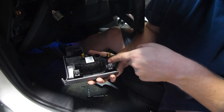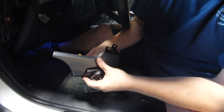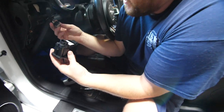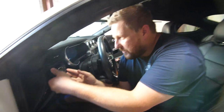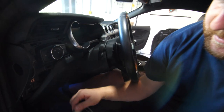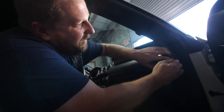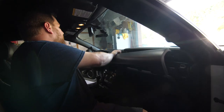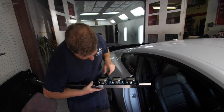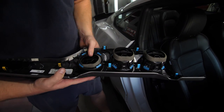There are four little plugs here, and you can hear the car going crazy because it knows it lost its little knob. Squeezing, pushing it forward, and it will come out through the front. While the dash is being painted, we'll plug this back in and let it rest in there — it's kind of loose, but the car won't make any noises and you'll still be able to drive it. We're just going to grab and work it loose. We'll have to remove these vents — they are just these little chrome clips, you just push them forward and two of them will pop loose.